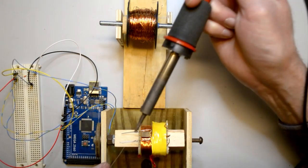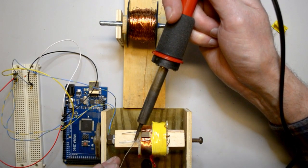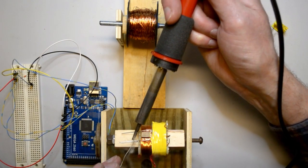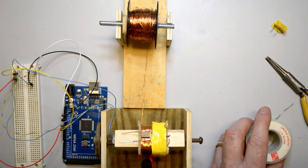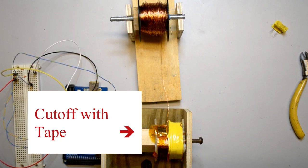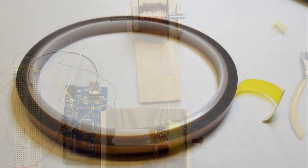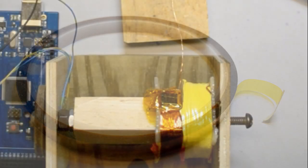Next, I'll attach the other leg of the cutoff to the wire we are going to wind back into the coil. They need insulation to handle line voltage. I use the special high temperature BGA polyimide tape. Once the thermal cutoff is insulated, I use a little tape to hold it in place.